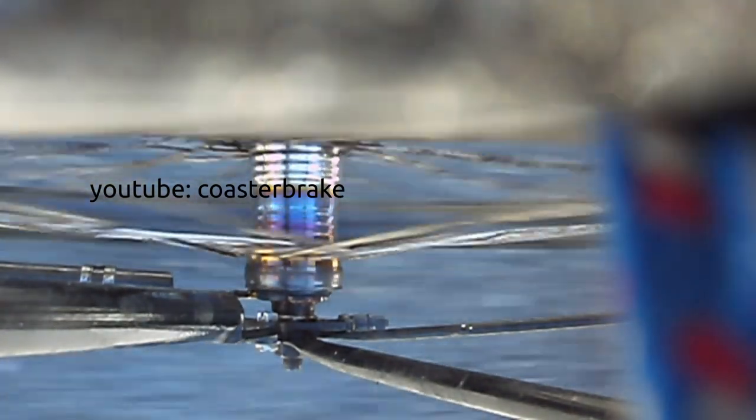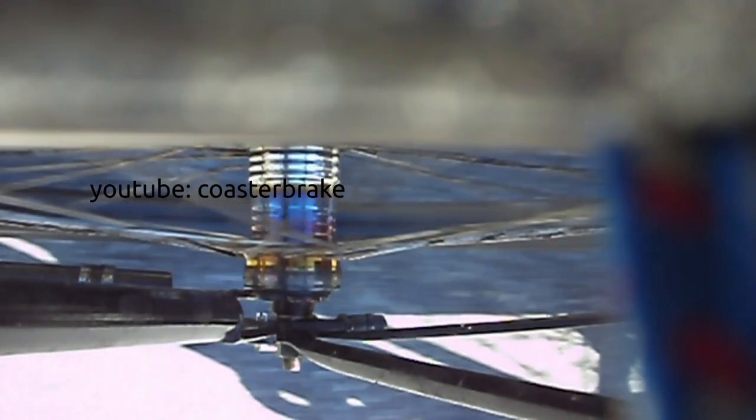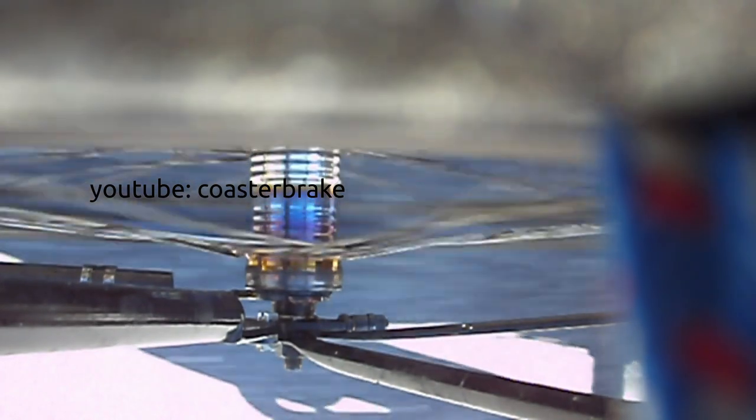The parts out of this hub shell, around 1970 or a little bit younger, are in very good industrial standard. If you have an old torpedo to repair, you can buy a little bit cheaper hub like this. It looks a little bit different outside. Take all the parts from the younger version out and put them into an old hub, and you will have a refurbished good hub for the next 10, 20, 30 years.